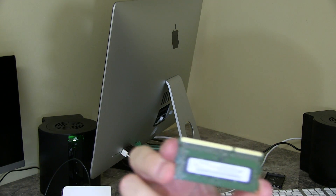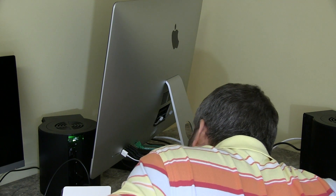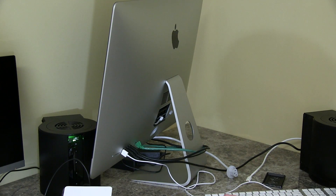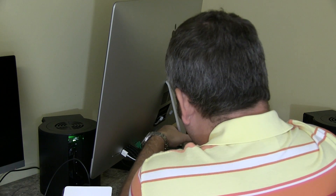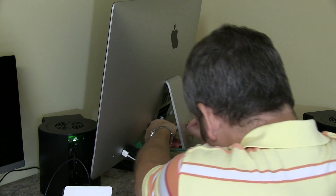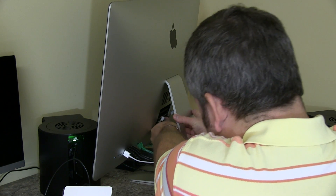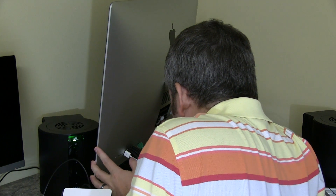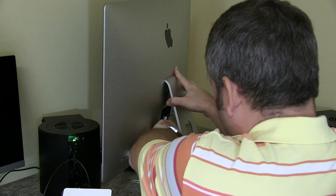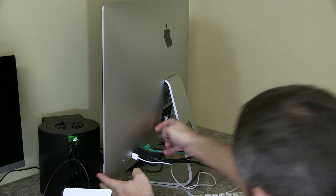There's only one direction that this will fit in your iMac. You see that groove right there? So you need to look in your iMac at those holes. On mine, the way that it's currently angled, it appears that the shorter piece — which is the top part — the shorter section is going to go towards the right. Just gently put it in there. Once you get it in the slot, you'll notice that it's in, and gently — don't ever force — gently depress each side and you'll feel it stick in. Not a loud snap or pop or anything, but you'll feel it sticking in that slot.